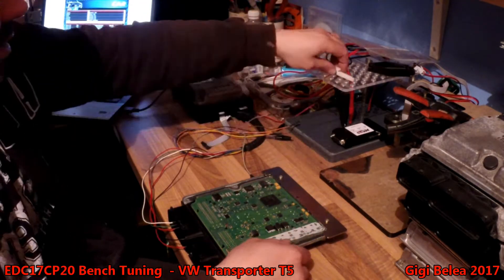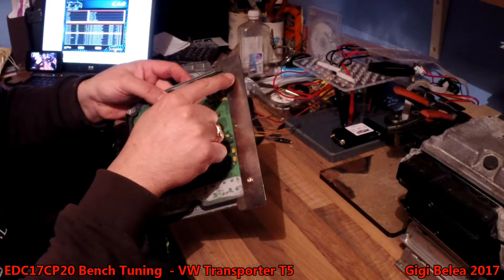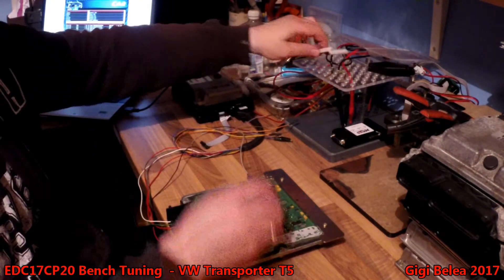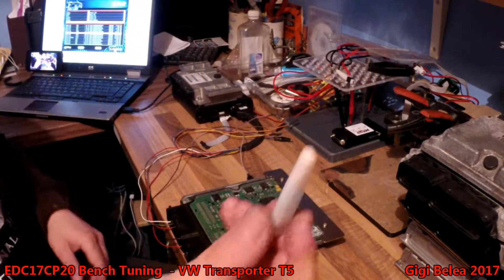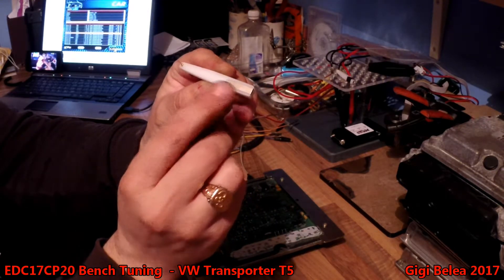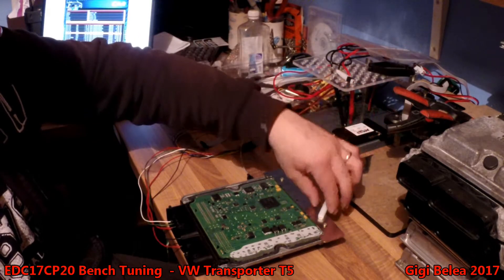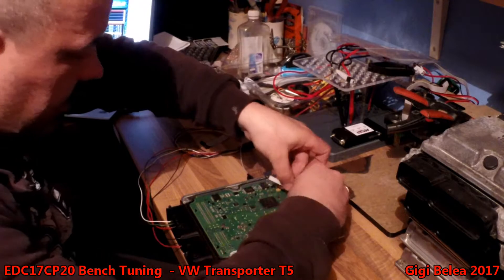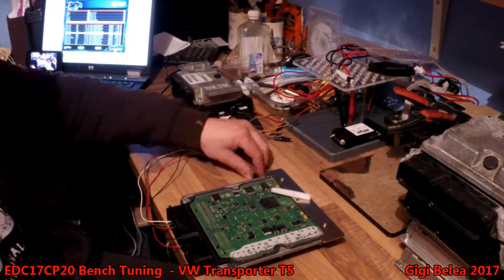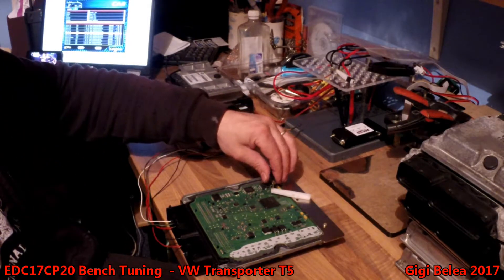It's an easy way to put the boot pin. As you can see, I have already this special plate — you can buy it, it's a metal, it's magnetic. You screw it here with two screws and it's sitting on the edge of the ECU. And with the help of one of these guys, it has a magnet here — you can see it, this is a magnet — it will stay on. This is a very easy way. So in this way you can just put it here, adjust it where it has to be on the boot pin, connect the boot cable, and it's very stable — it doesn't move and it's making a very good connection.